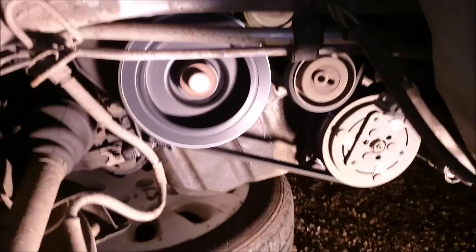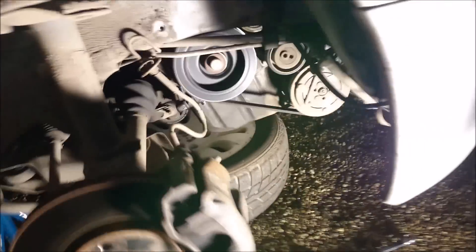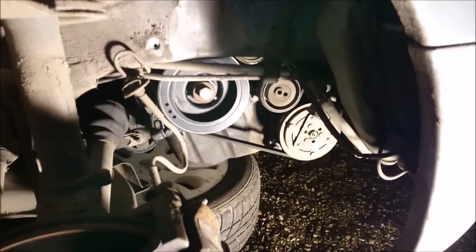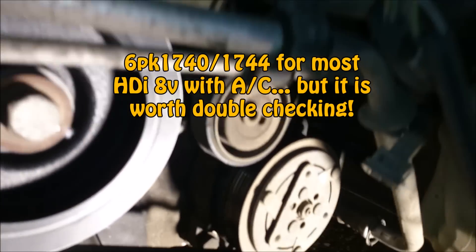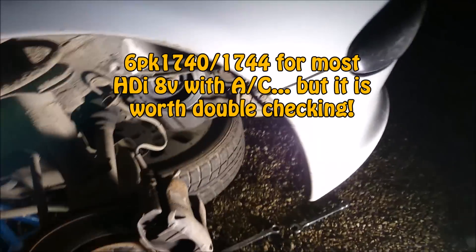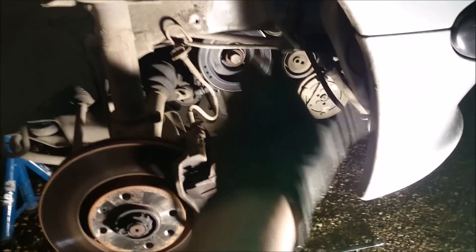And there we go — wonderful. That's another reason we've done it, because it was starting to make a heck of a noise when they start rattling around in there — they squeak and rattle away. Also note: if you can look closely, the belt is showing a few cracks, so we're going to have to order another one and do a service later in the week. Now we're going to just put the trims back on underneath there, the mud panel splash guards, put the wheel back on, and you're good to go.